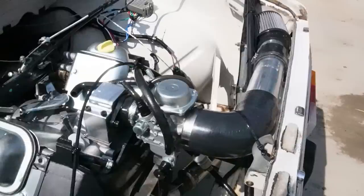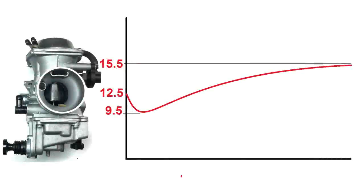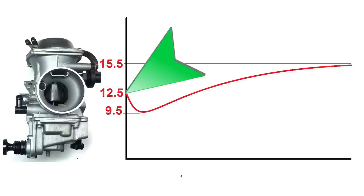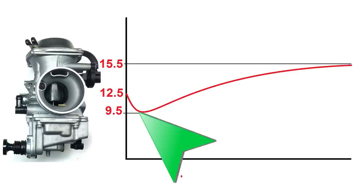I did learn a thing or two from the comments, and I was able to verify that I didn't completely understand how the pilot jet worked on this carburetor. This crudely illustrated diagram from a previous video is not to scale and not 100% accurate. What it does show is we have a perfect mixture at idle, and then at part-throttle the mixture goes rich, and as the car accelerates the mixture goes lean. We can rule out the air filter and the fuel pump system — we do in fact have an air filter, and the fuel pump is providing plenty of fuel. So let's talk about the pilot jet. We have a good mixture at idle due to the idle mixture screw being properly adjusted, and this fuel is provided by the pilot jet. At part-throttle when we go rich, this is apparently fuel also being provided by the pilot jet. This dip in the air-fuel ratio will hurt fuel economy, but on the acceleration test it's a mere blip at wide-open throttle.